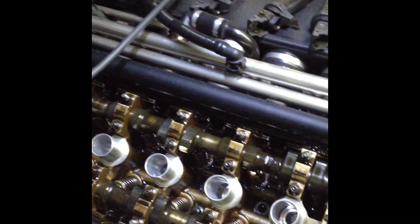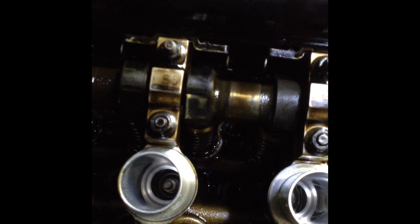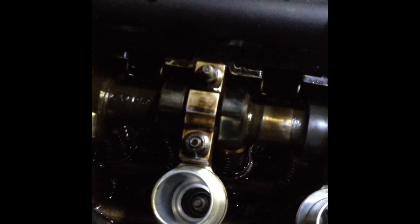We're going to be doing this handheld so just bear with me. Looking at the sheet, we're going to be going on the Inlet Cam Cylinder 5 on the right-hand side, which is this one here. We've already done the measurements and they should match up with what I'm going to show you now. So the 0.20 feeler gauge goes in on both sides, and the spec — the highest tolerance you can find — is 0.23. The next gauge up is 0.25, and if this goes in, yes it does, albeit very tight, but if it does go in it's showing it's out of spec. Only very slightly, it's just borderline, but rather than leave that we carry the shims in stock, so we replace these as we go. The customer gets an extra couple of pounds on their bill for a shim, but safe in the knowledge that their engine is going to be performing well until their next service.